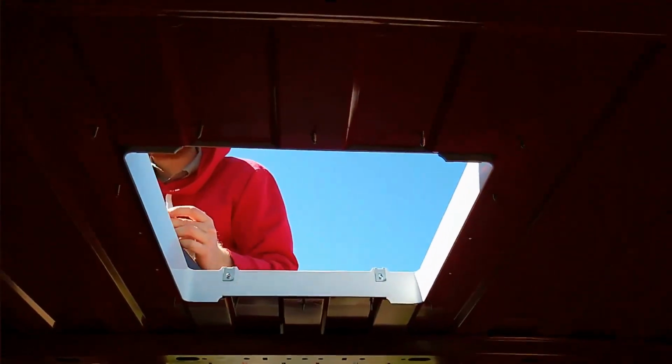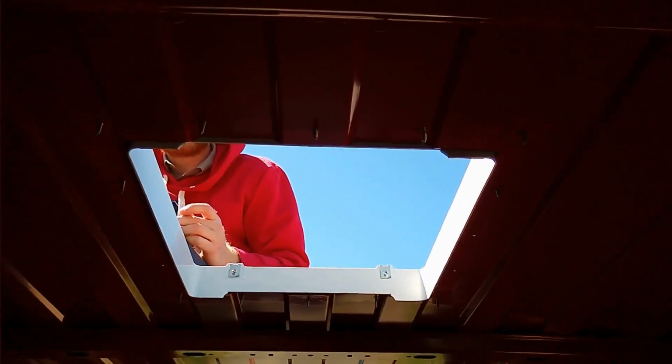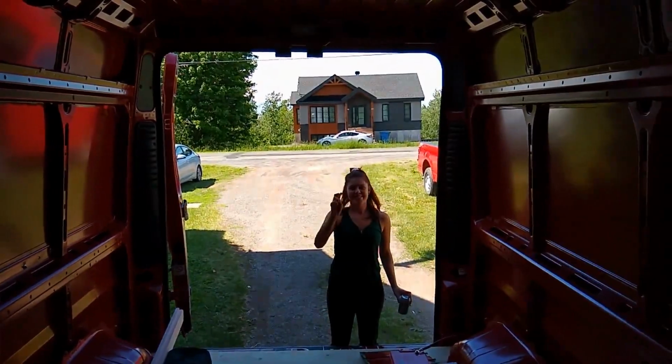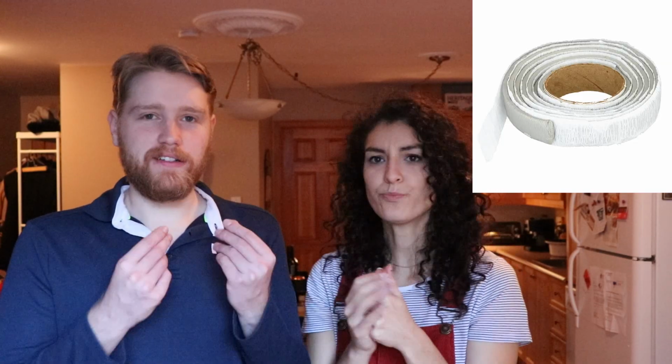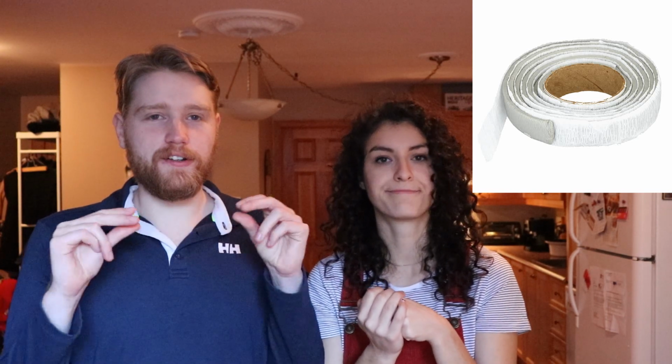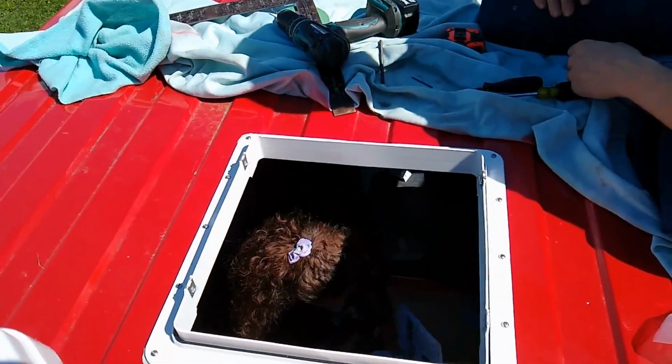And then we installed the fan. One super important thing is the space between the frame of the fan and the roof. So you have putty, some sort of rubber putty, sticky putty, that you put underneath, and to double it up, you put sealant. You should put anti-water sealant all around, like the stuff you would use in your bath or windows. Go generously. Put a lot, and also on top of the screws.